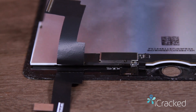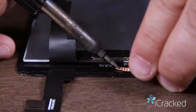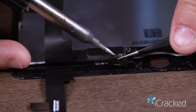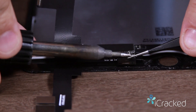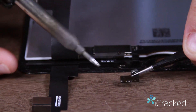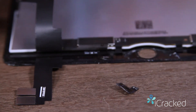What you may have to use is the Super Wick to absorb any solder that may be stuck. You see, it just slid right off. Now there's enough solder left in here that I should not have to add any new solder to the new display assembly.